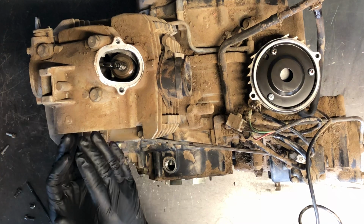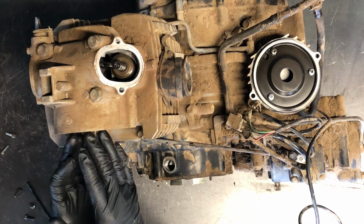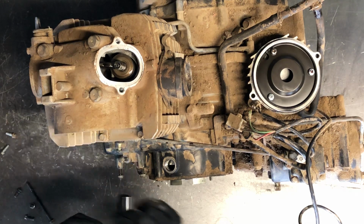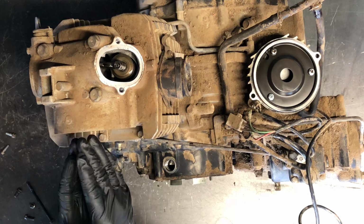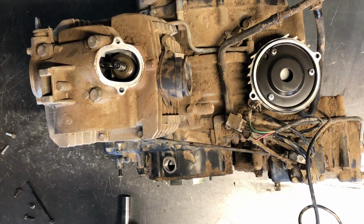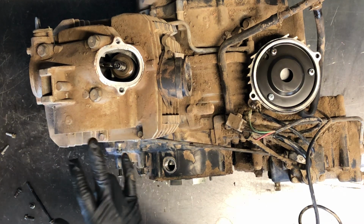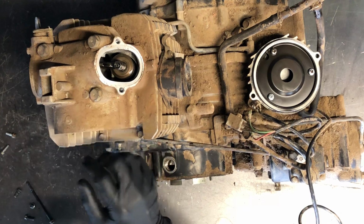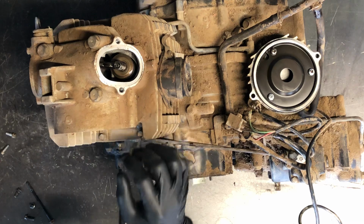So this looks like it's slightly off, and sometimes they do, because it's either going to be slightly back or slightly forward depending on where your chain ends up. This is slightly back. If you look down, again I'll show you the picture, but you can see a top written right there. You want this to be right in the middle of the top, and it's slightly to the right of there.